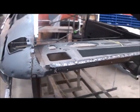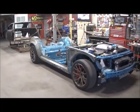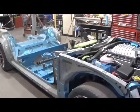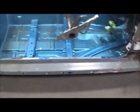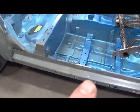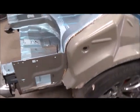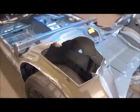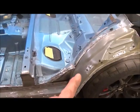Hopefully I can get this back in shape and start moving forward again. Here's the first setup after doing all the work on the car. I've cleaned all this post out and cleaned that metal up a little bit. All the way down through here I've done all this work - put all that new metal in, welded a little quarter-inch plate in there, and cut all this back up. Cleaned up all the edges, dressed up all the slag and sharp stuff. Made that plate, added a lip all the way back, cleaned that lip all the way up, and it's pretty much ready to sit on there.